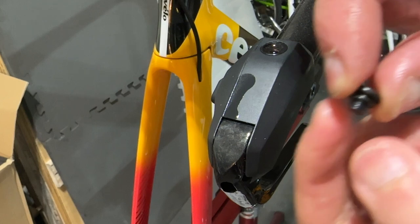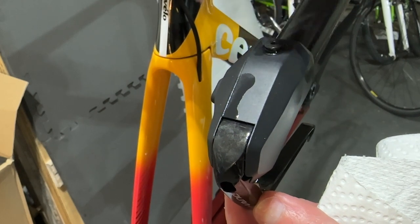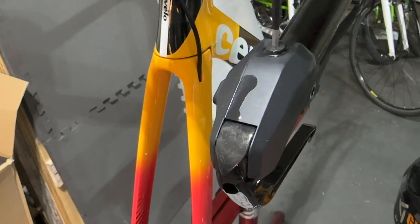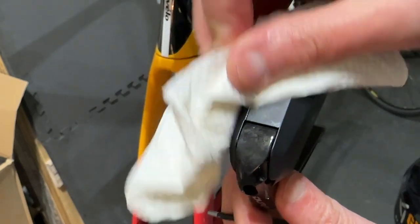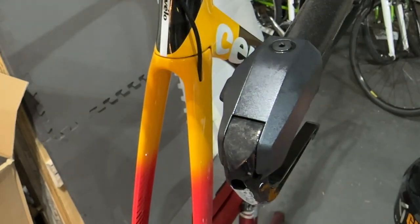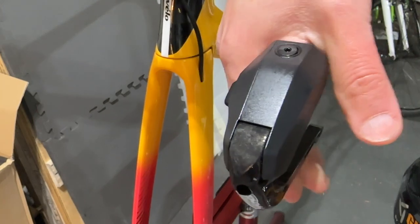First, we make sure that the washer is still in place. Just going to put this over here, and the idea is you don't want to over tighten this guy. You want to be gentle. Oh, by the way, this is a 2.5 millimeter wrench that I use, and I'll probably clean this up and wipe this down later on. So that's how I finished the left side. Just making sure I don't over tighten, but it's tightened enough. Okay, great. So yeah, feels pretty good.